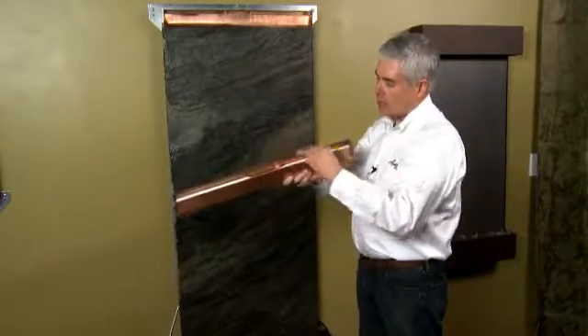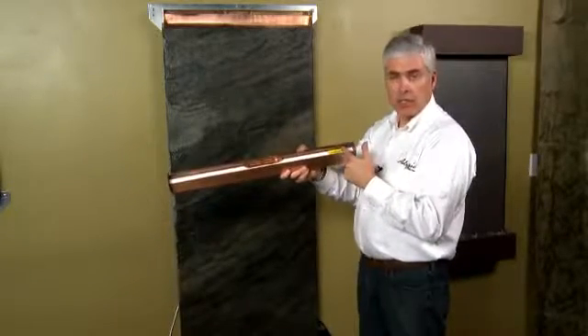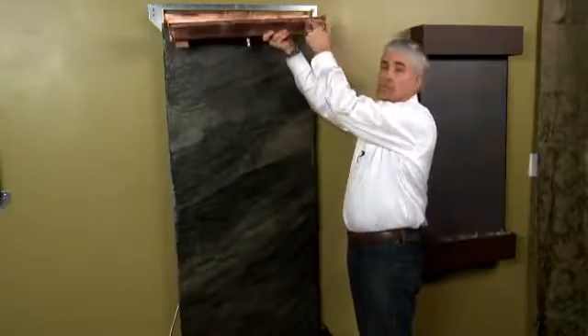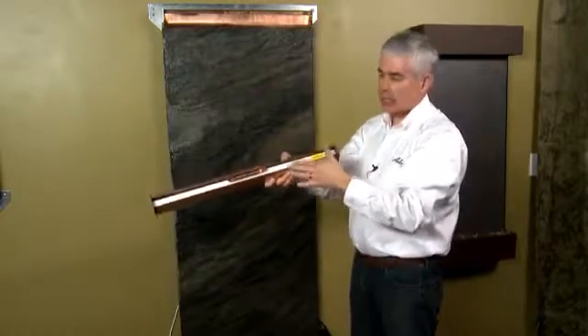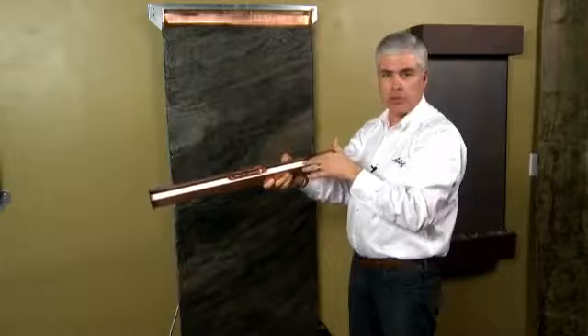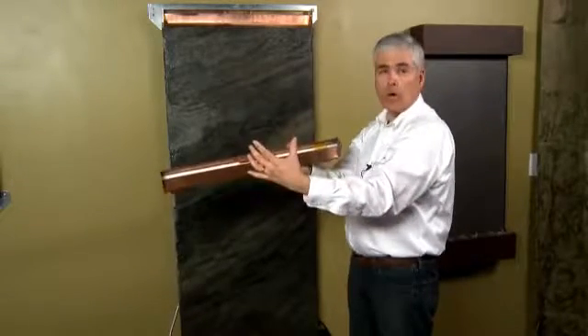So it's important that you take a look and make sure that the white plastic baffle, where the arrow says pointing to the wall, is indeed pointing towards the wall, and that the top of the white plastic is squared with the water distribution unit. This will prevent any water from coming up out of the water distribution unit and splashing down the fountain.